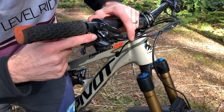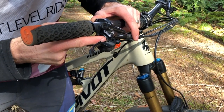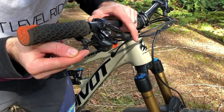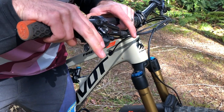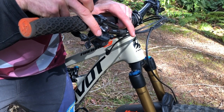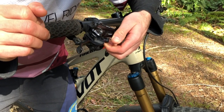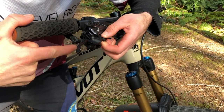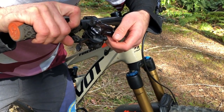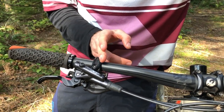Usually on a kids bike, just inside here there's a little allen key adjuster, and what that does is when you turn it, the lever adjusts closer to the bar, so you want to make sure that the child can grab the lever easily and reach it. On these particular brakes you can use this dial here to adjust where the brake lever sits — you want to make sure that's in a nice place for you. So that's the reach of the lever. The other thing to think about is where the lever is positioned on the bar.